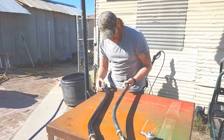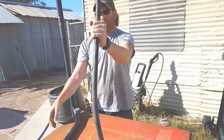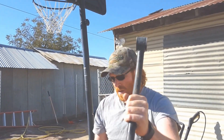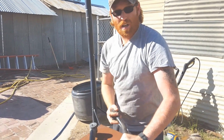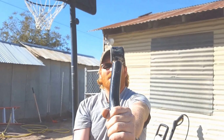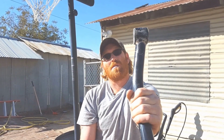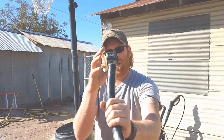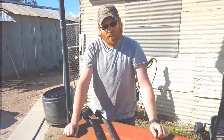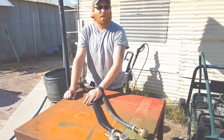And unlike this piece, if you look here, where it bolts up, it's just straight. But on a WJ, you actually need it to be kicked just slightly so it bounces up. If you notice, this one is actually kicked off a little bit, so it lines up perfectly with the holes. No problem with installation, slid right in. Absolutely ecstatic with it. Anyhow, that's my review on the Rough Country versus the Rusty's Off-Road track bar.